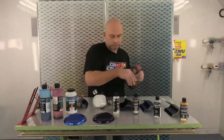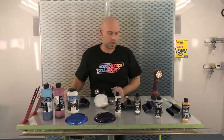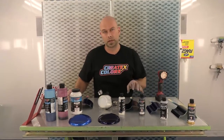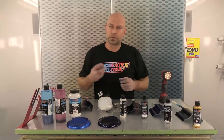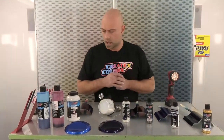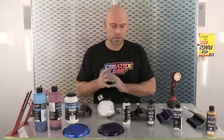Before I clear these, I'm going to spray a 2K clear over the top. If you've seen our other videos, we do have a high-gloss top coat, the 4053, but we find that the 2K works a little bit better when spraying over candies. Sometimes the candy has a tendency to bleed into our 4053, so we recommend a 2K for maximum holdout — the color, the shine, and the holdout.